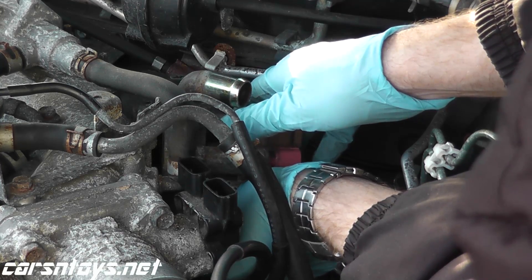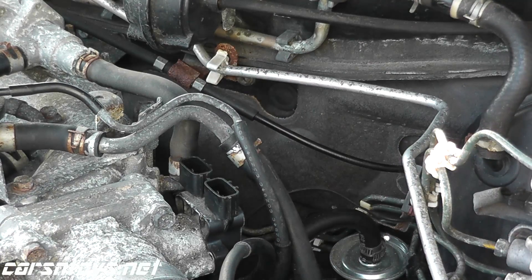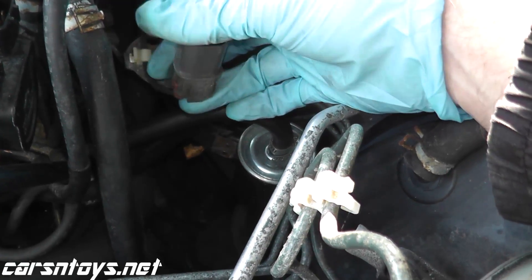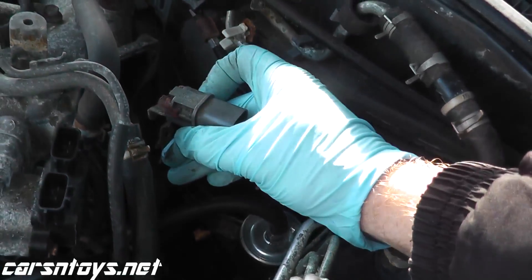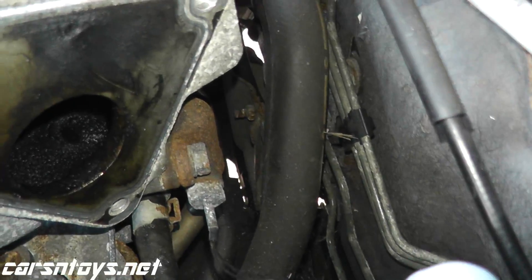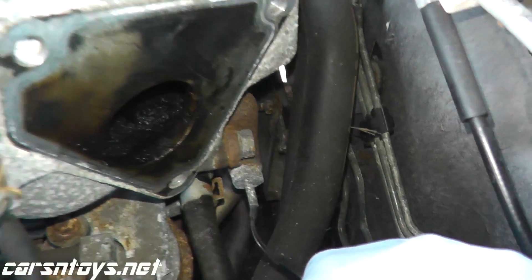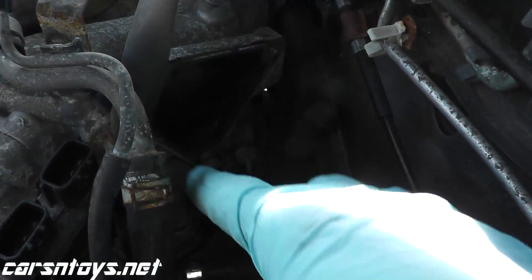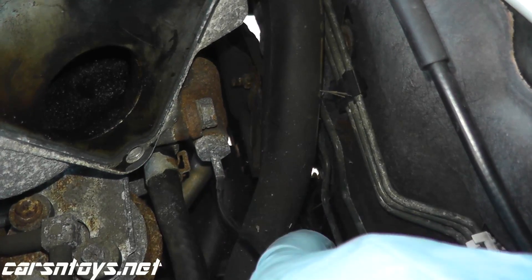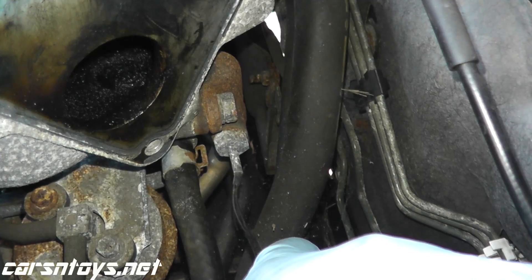Whenever you work on cars, the more room, the easier it is. Here's the harness connector — the end we disconnected the harness from. If you follow the wire, it will lead right to the temperature sensor. On an older Maxima, right here was the idle air control valve; just remove the two or three bolts, and right there is the temperature sensor. It's a 14 millimeter. I sprayed a little WD-40 and I'm using a small wrench. The room is so confined I can't get enough grip, so I'll place the wrench over the nut and use a screwdriver as a pulling point. And we got it loose.